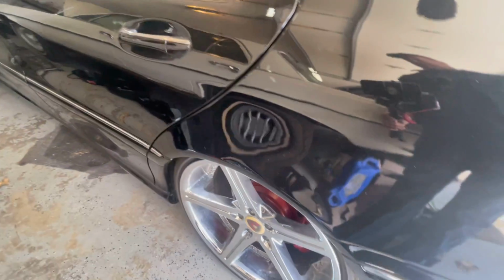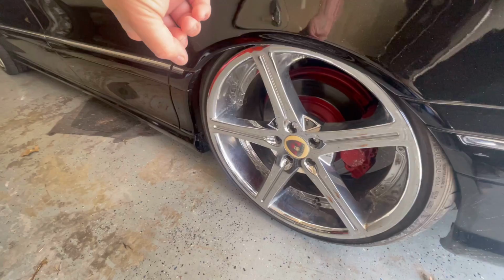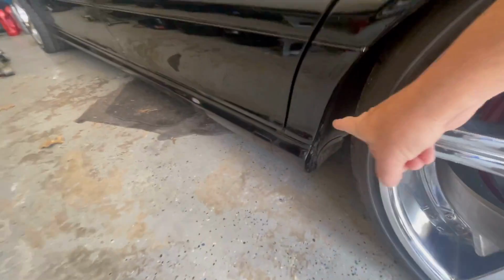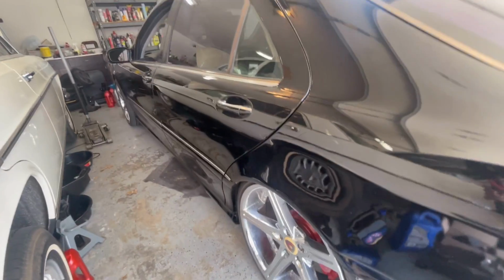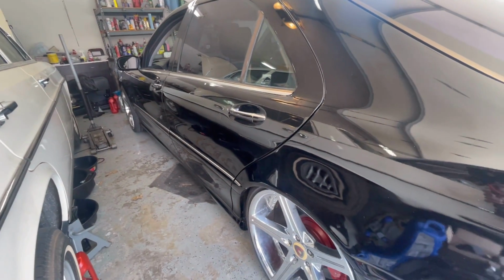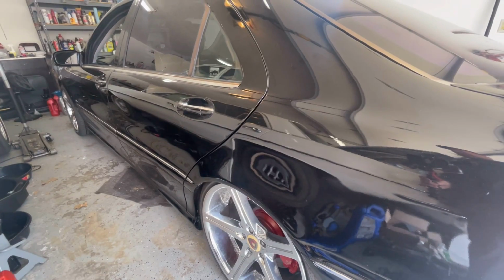Yep, she is sitting very, very low. There's the squat. The valve block is right under this cover, right here. Because there's no hydraulic fluid anywhere, we know that the valve block has a leaking solenoid. So what we're going to address today is that.